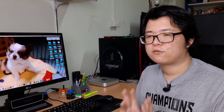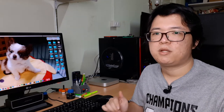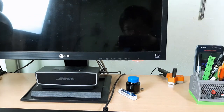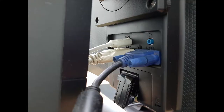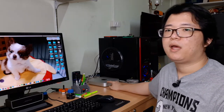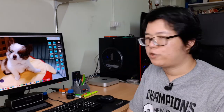In order to connect two computers to the same monitor, you need a monitor that has two inputs and an easy-access button for input switching. For example, the monitor I'm using has HDMI, DVI, and VGA inputs. I use HDMI and DVI — the HDMI connection goes to the Mac Mini and the DVI connection goes to the PC.